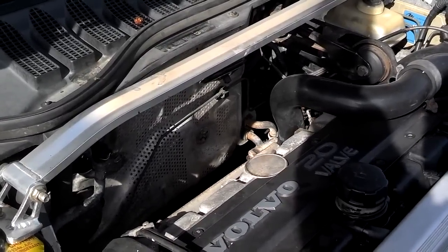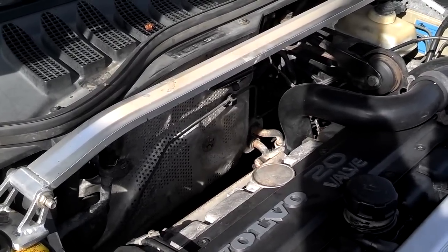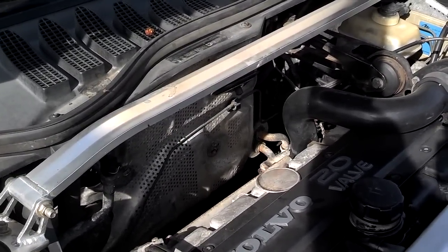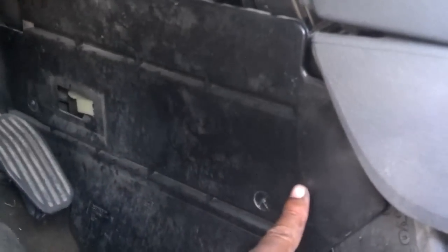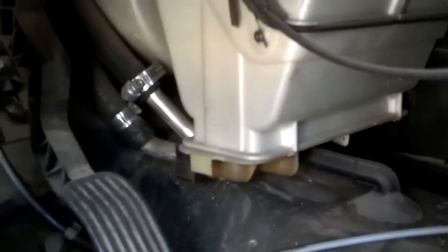My solution is, if you don't have written, documented proof that the heater core has been replaced, go ahead and replace it. You can get them as cheap as $40 shipped, and it's a 30-minute to 60-minute replacement — very easy job. Protect your car from overheating and losing its coolant rapidly through the heater core system. You come on the driver's side of the car, peel the carpet down from around the gas pedal area, then you'll see this plastic panel here. You remove that plastic panel, then you'll see the heater core.